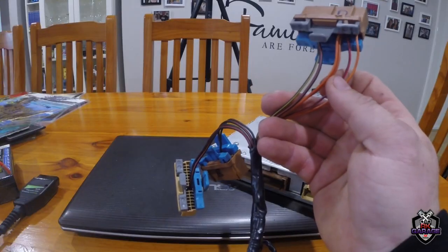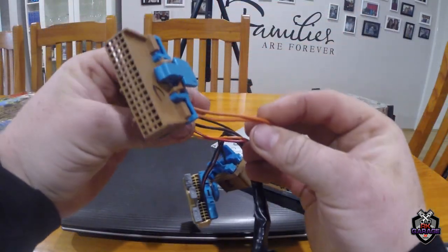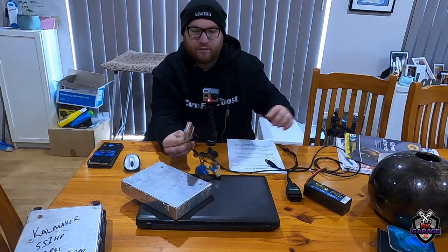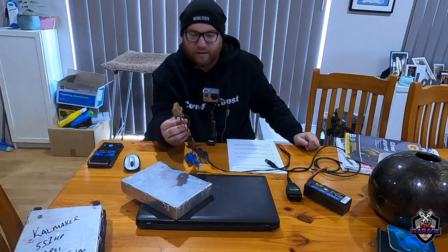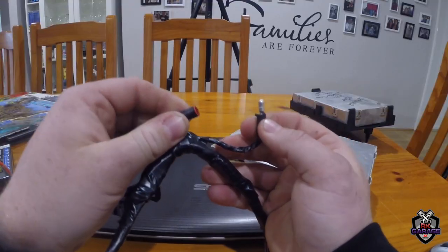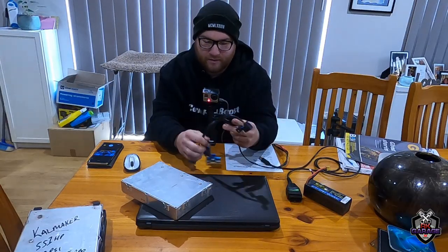You want C12 and D12, which are these two thicker orange wires here. Then you have an ignition switch wire which you can wire straight to the battery or 12-volt source to make it work — or wire in a little switch so you can twist and untwist wires to act like a key turning on and off, to do a soft reset on the ECU after flashing. I've just used butt connectors so I can manually pull it in and out.